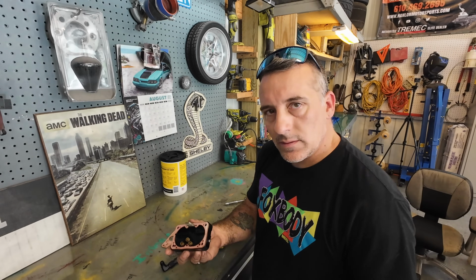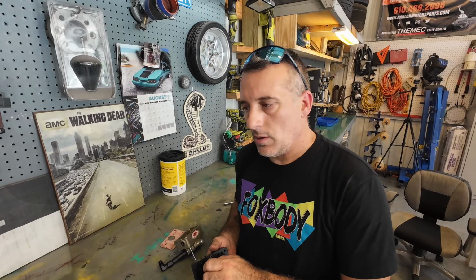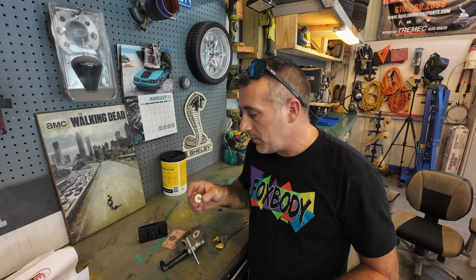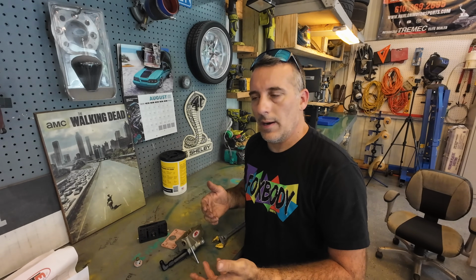I just wanted to add to the video that it's the next day. This is after we put the gears in, and I'm going to change a power valve out in this car. I did not realize that this thing has an 8.5 power valve in it. This was an 8.5. I'm going to put a 2.5 in it, and this car pulls around 8 inches of vacuum when you're cruising around.